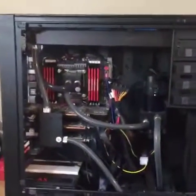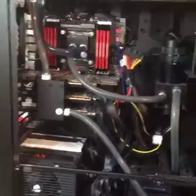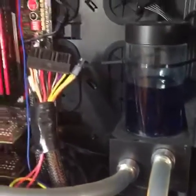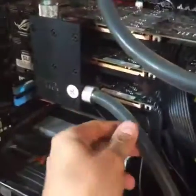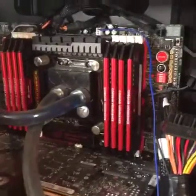So this is the way the system looks. It's an EK water blocks setup with soft tubing, and as you can see, the tubing has actually changed colour. This was a blue liquid, but the tubing has changed to a kind of greenish — it's a plasticizer effect. So I'll have to take apart the water blocks and give them a good flush, including the CPU water block.